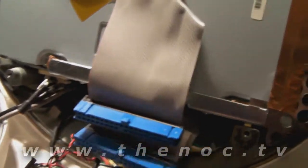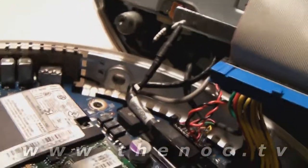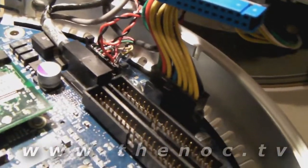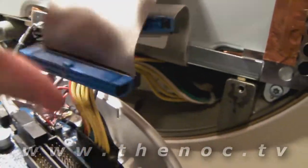That should be it. I've gone through and reconnected the two ends of the power connector, put the grounding screw back in, connected the main power and additional connector. I put my four screws at each corner and the two for the shielding. I'm about to go ahead and close it up, but I wanted to show you one thing first that would be hard to show once the case is folded back up.